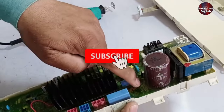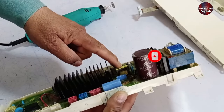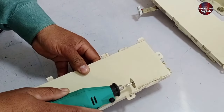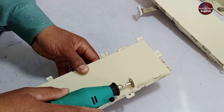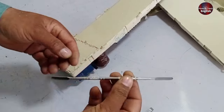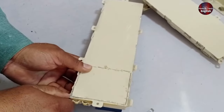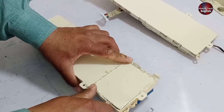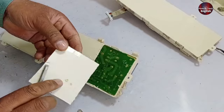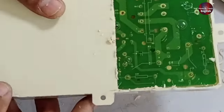I am checking that the rectification circuit is here. A DC chopper is also installed here. First I will check the rectification circuit, so I will cut till here to check it. While cutting the plastic from the center, I will be careful not to apply too much force to prevent PCB board damage. I have thin scrappers — by inserting them inside the plastic I will remove it by pushing upwards. Now I will take a hardened tool, through which it has easily come upward. Now the PCB from beneath is also visible, so I am going to check the problem.